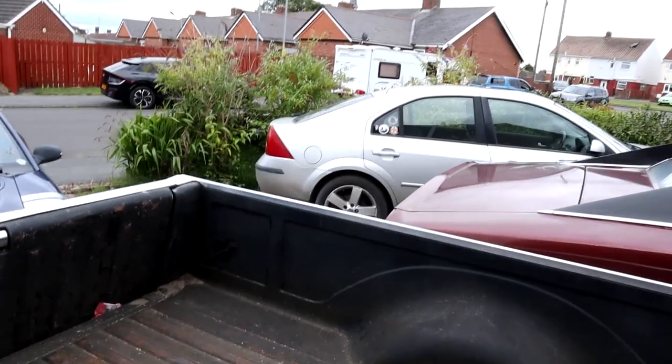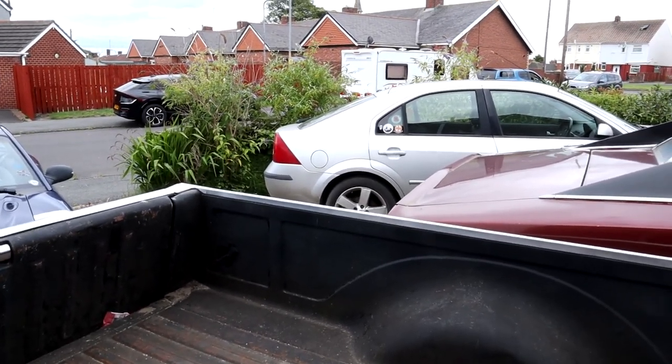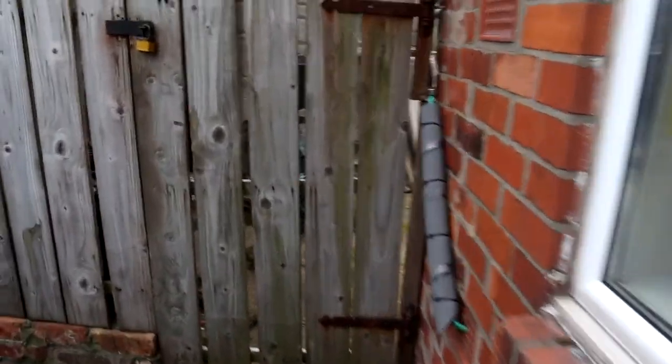of how long it stood, I don't know if you made it out on the camera or not with all the engines running, but the two back wheels seem to have seized on and they're on disc brakes. So I need to free off the brakes on the back wheels. I didn't park it with the handbrake on, so it hasn't been sitting with the handbrake on. Never do that when I leave a car standing for a while.